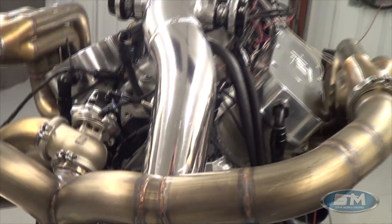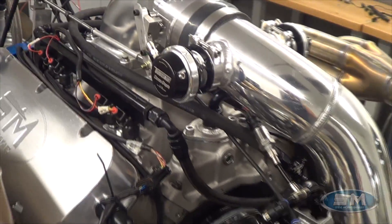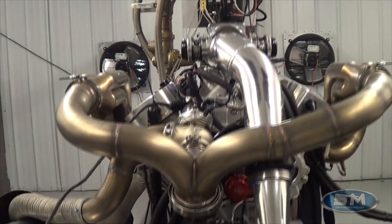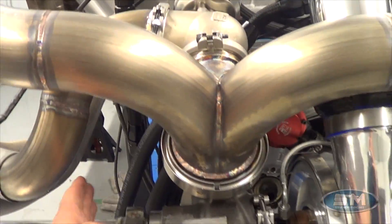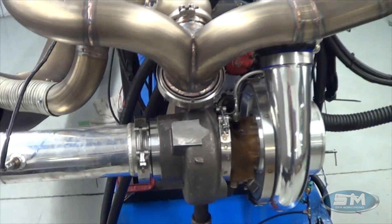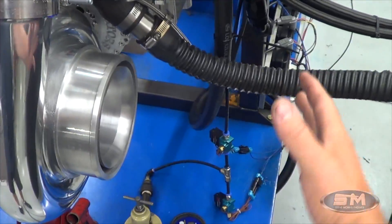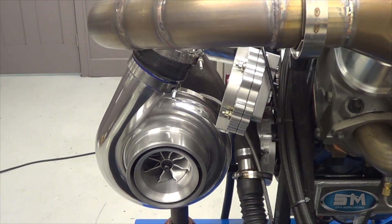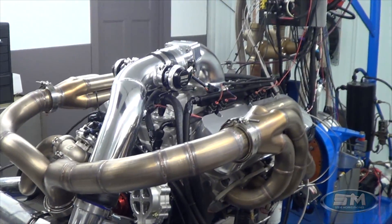This is actually something we're going to be doing a lot of testing and development work on, and pretty darn happy with so far. This is what we're going to be calling our Top Dragster package. This engine fits in that Top Dragster format. You can see the headers — the frame rail will go right through here. Everything fits, with a bull's horn exit outlet on the side of the car and an air duct off this side with an air scoop. It's only 15 inches from the leading edge of the turbocharger up to the face of the block, so it packages nicely in Top Dragster applications.